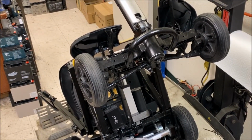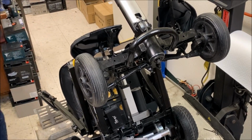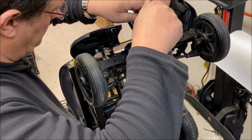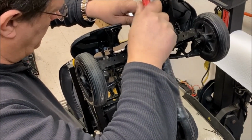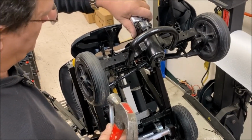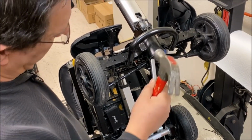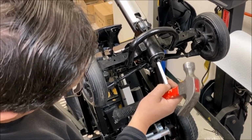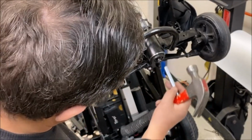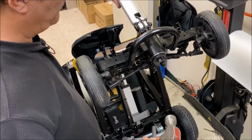If you're a little bit unsure, get a set punch, just tighten it up with that. Just give it a nice tighten up, so it's loose enough to steer, but not too loose that it's going to damage your bearings top and bottom. Don't be undoing that, that separates that and that. No need to undo that. There are your tie rods for your steering. Just give it a little tighten up there.